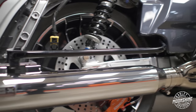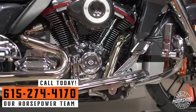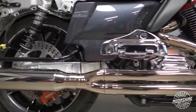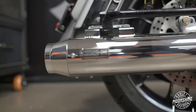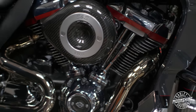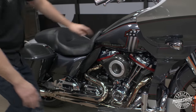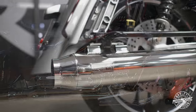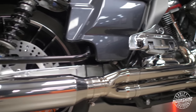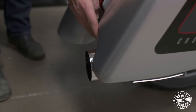We get live inquiries on the exhaust pipe on this bike. The best way to get it is to call us because we have options for different size collectors and different size mufflers depending on your application. We might need a bigger one or a smaller one. Fueling has patented the chamber on the exhaust pipe and we've teamed up with those guys. This is what we call the Pro Mod — a two-in-one Pro Mod with patented anti-reversion chamber from Fueling. This is the polished stainless steel version. It will turn gold after it's been heat-soaked. We have two muffler options: one made for extended bags that comes out to the back of the bag, and one shorter for standard bags.